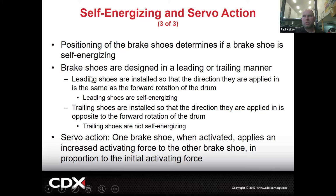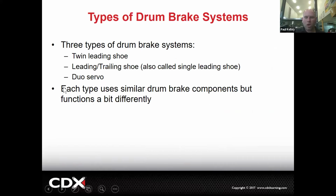And then this is essentially just summing up where the leading shoe and the trailing shoe is. So I call it the primary and secondary, but leading shoe and trailing shoe, they're more specific to which one's self-energizing or not self-energizing. So it's the broad strokes. Exactly what's happening, ASE is not going to ask. In fact, for the technician, you don't even really need to know exactly how it's self-energizing and why it's self-energizing. You just need to know there's a reason that the secondary shoe is taller. And it's important that the secondary shoe is put in the back